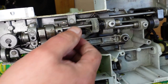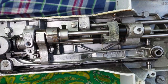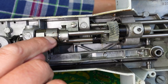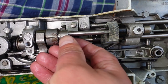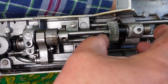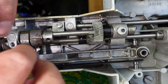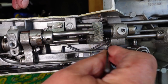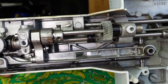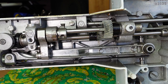The easy way — I've seen it done the hard way — is to turn the machine in the operating direction until the needle bar is at its bottom dead centre, then bring this mark up to this mark here whilst holding the machine, making sure the machine doesn't turn while you're doing that. Then get rid of that backlash, make sure that end play's gone, and tighten that screw there — just like that. And that is your feed timing done. Let's double check it again.